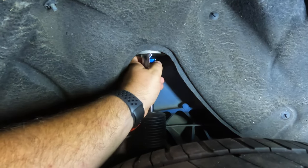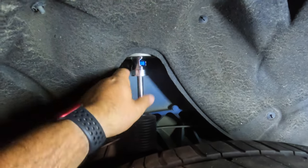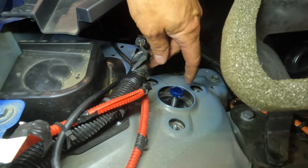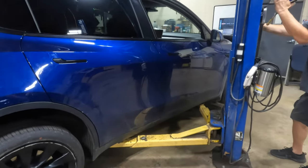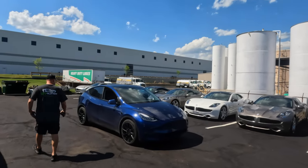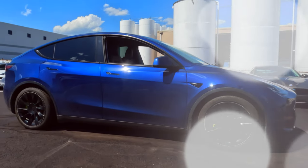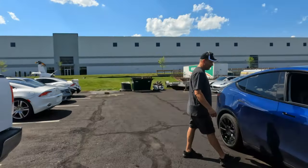This is on the rear. Here is where you reach in to change how soft you want the ride to be. That adjusts the dampening, and it has a little click so you can change it. And there's your front adjustment. You can see soft, harsh. So we're at 6 clicks right now from the maximum. Oh my gosh, it looks like a car. Let's go drive it, this is awesome. Let's go.